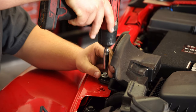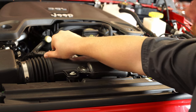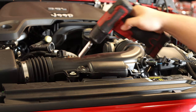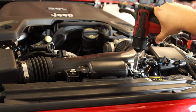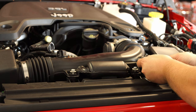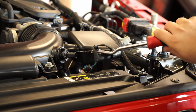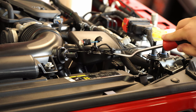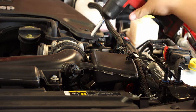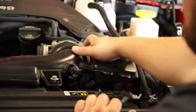I'm going to use a gun to make it a little bit quicker. Get that pulled out and set aside, then we can move to the center. In the center you have your PCV hose, which simply removes by pushing the gray section and pushing it backwards — it might be a little tight since it's the first time. We'll move on to these two 10 millimeters that hold on the center section of the intake tube, then move on to the mass airflow sensor by simply depressing and pulling off the back of the sensor. You need your trim removal tool to pull both of these push tabs out — just go underneath them and rock them back and forth until they pop out. You can do this with a flathead screwdriver too, so you don't need any specialty tools.